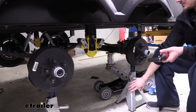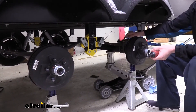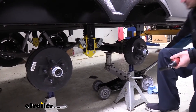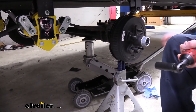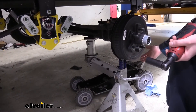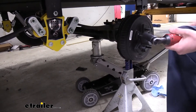The jack stands I've got here are just precautionary stands underneath the axles, because we're going to be taking the U-bolts loose and once we do, the axle can drop down. I also have my jack underneath the axle and I'm going to be moving it around and keeping it under the axle I'm working on, because the jack stands are really just supplementary — in case something happens to the jack, such as fluid leaking out, the jack stand is there to support it.